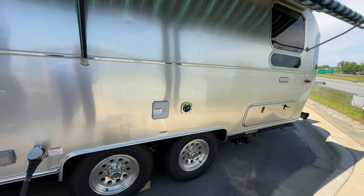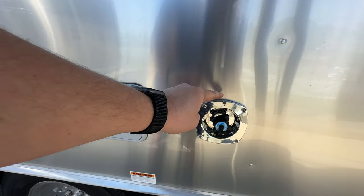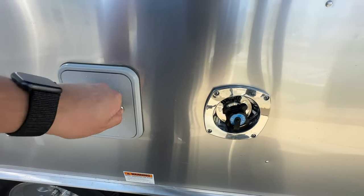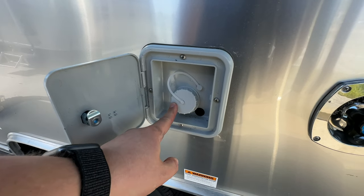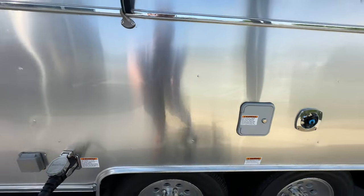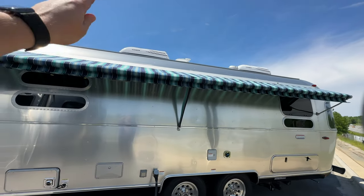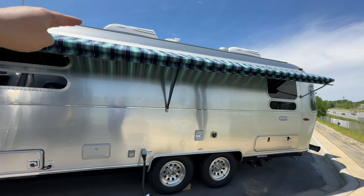Right here is your city fill inlet, which goes straight to your faucets and shower. It has a pressure regulator already built in, so don't add an external pressure regulator — I incorrectly said to do that in some early videos. Behind this door you've got your gravity-fed potable fresh water fill with a little seat valve. Fill it up until it comes out and you're good to go. On this side you've also got your axles. Something Airstream does that I almost always forget to mention — the AC condensate.